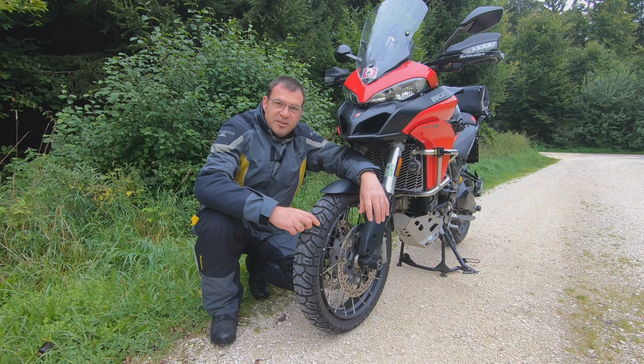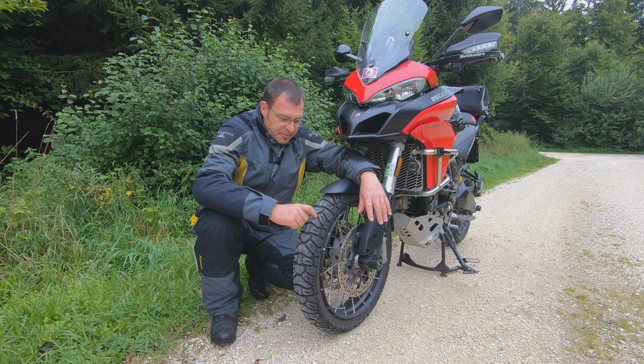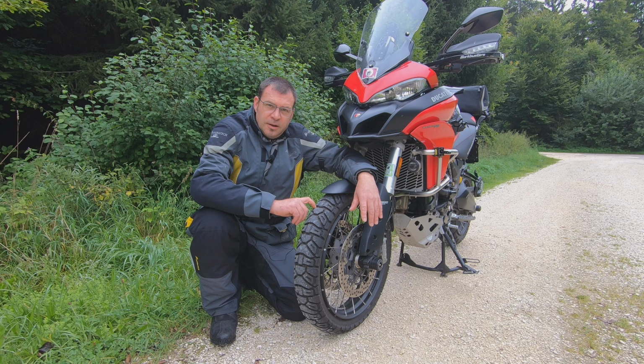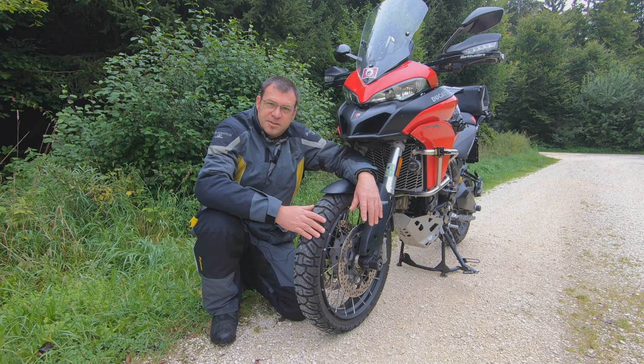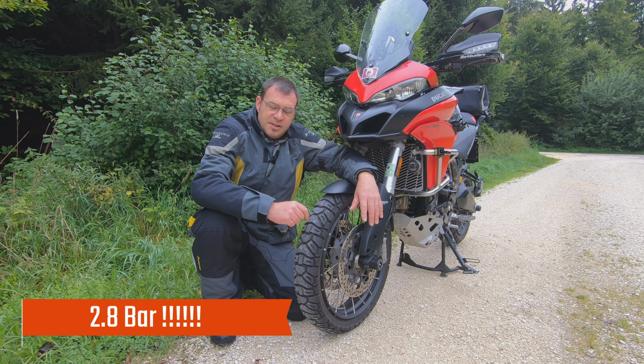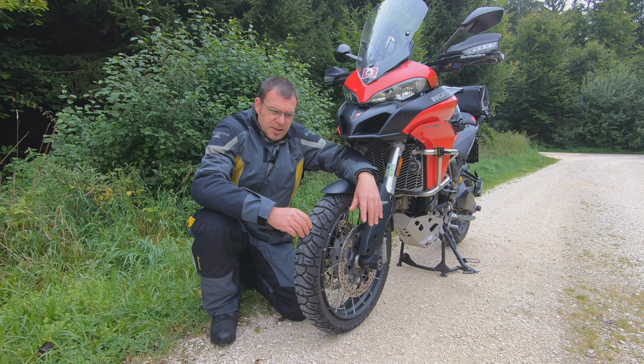I did about 5,500 kilometers with the Dunlop Trailmax Mission tires here on my Multistrada 950, and I have to say, I like them pretty much. I tried a lot of different tire pressures. I started with 41 PSI, which is recommended by Dunlop for these tires. They didn't work well. How should I say? They are rough and just too hard.